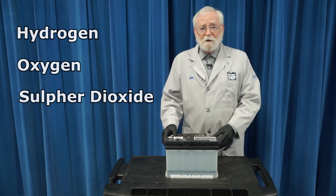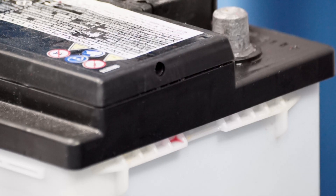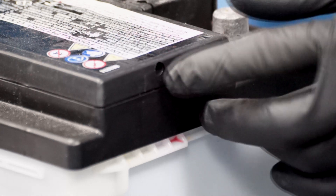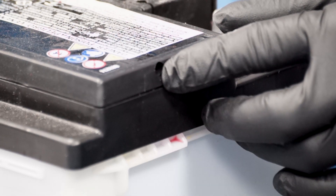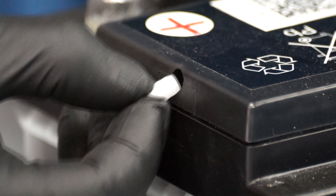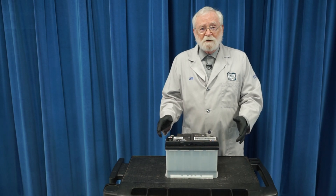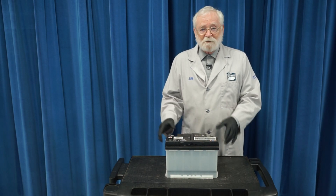And so, for that reason, they're vented. If they weren't vented, they would bulge and burst. Batteries that are mounted inside the vehicle somewhere actually have vent holes, one on each side, and this of course is where the vent tube goes. The vent hole on the other side of the battery will have a plug in it. When the batteries are located under the hood, these gases simply enter the atmosphere.